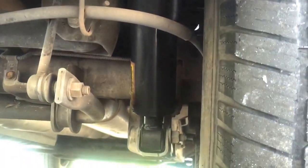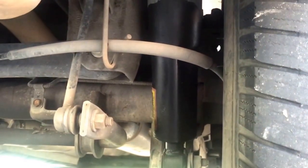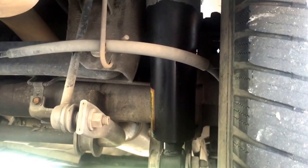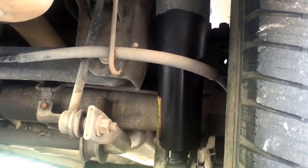So we need to put shocks on it. I had planned on doing that anyway. It's had front shocks put on it, but they put some cheap ones on — they do not ride well. They're way too soft and don't give it enough control.